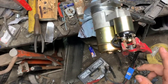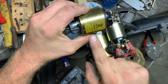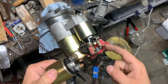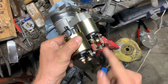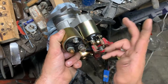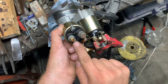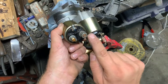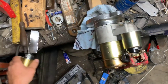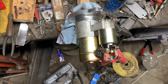One thing I did notice is the old solenoid has a marking for the battery terminal on this side, and the replacement one doesn't. So if you just kind of hold it up, your start terminal should be on the bottom and your battery terminal goes to the right-hand side. The other one that comes down through here is the one that goes to the starter. So battery here, and the one that goes to the starter on this side. As always, thanks for watching — give me a thumbs up and subscribe.